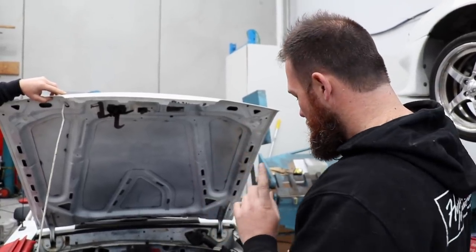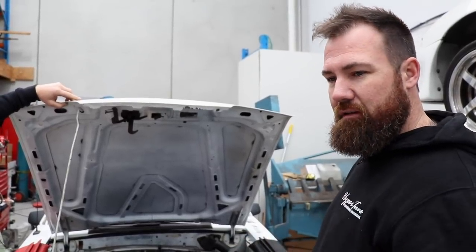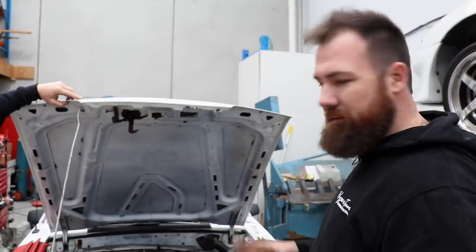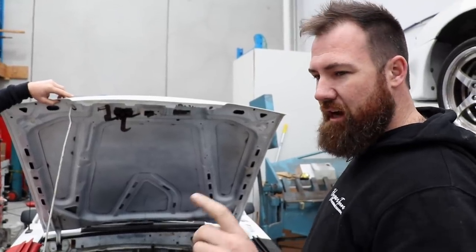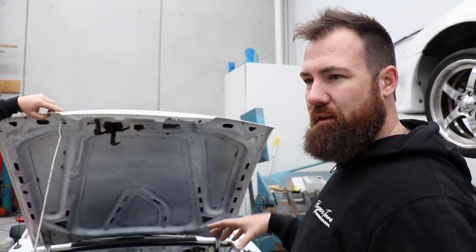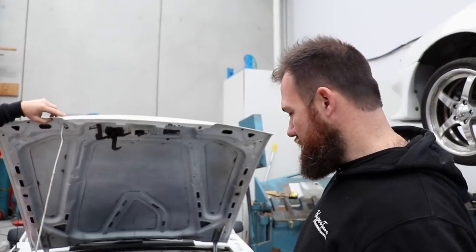Want to do all of our wiring harness. So we've already got a Haltech Elite terminated loom for the Barra. So there's going to be a few things we're going to have to add and change. Like we're not running Ford OEM style ignition coils. So we have to delete the IGN6 igniter that's wired factory into the loom.